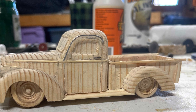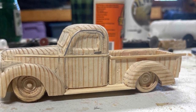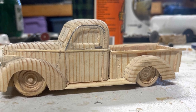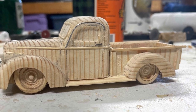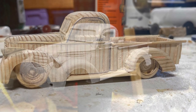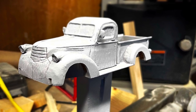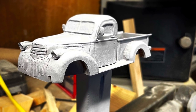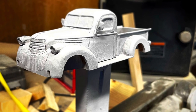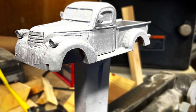I installed door handles on both sides. Just before painting, I go over the whole truck with 220 sandpaper and try to make it as smooth as I can before priming. The primer process is in three steps: first I apply some Rustoleum sandable primer, then resand everything with 220 to 400 grit sandpaper, followed by a primer filler and then a primer sealer.